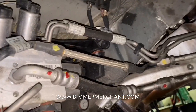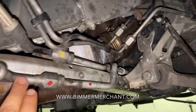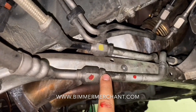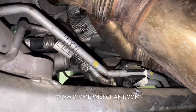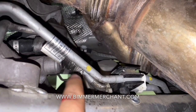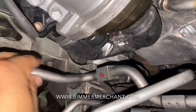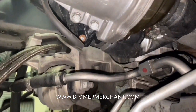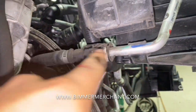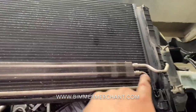Let's start — I color-coded them. The first one is this lower hose, I did red. This hose comes from here along the side of the car; it disconnects from here — I believe this is a 17 wrench. This hose goes up here, down there underneath the downpipes, and it comes out here, goes to the front, comes out here at the passenger side front, and connects right here, circulating through the cooling system up there.